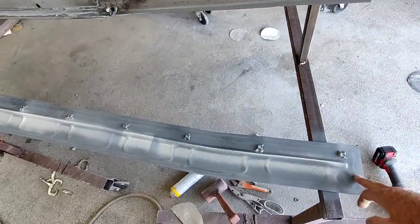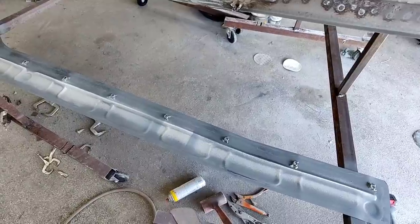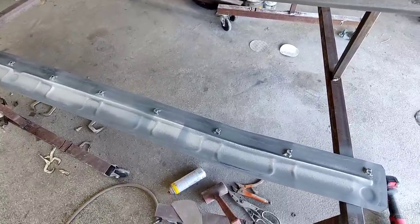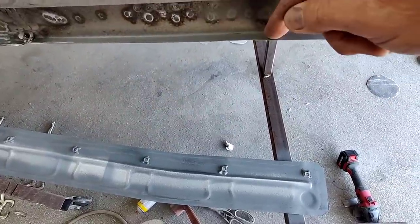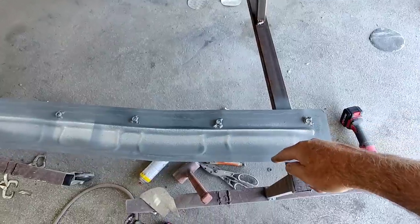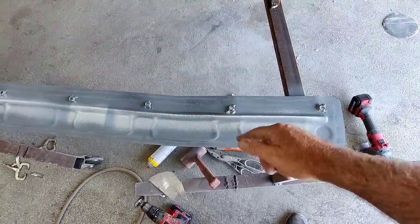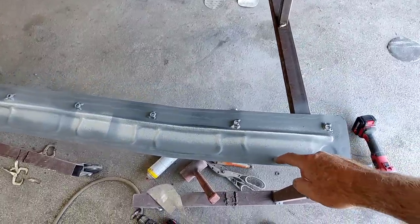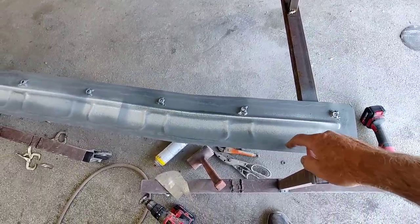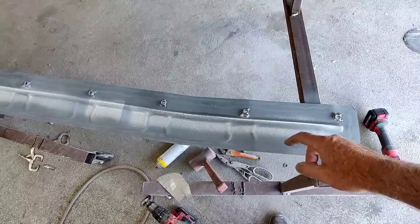And like I said, I have a weldable primer around all the time, but I don't like to use it. Even Fitzy's Metal doesn't use it. What he says is, you can drill through here, take a dull drill bit, knock and paint all this, and then you can knock the paint off of just those areas, and it'll do the same thing. And he's right, because right where you weld it, that weldable primer is gone. It's gone right in that area where you welded it.